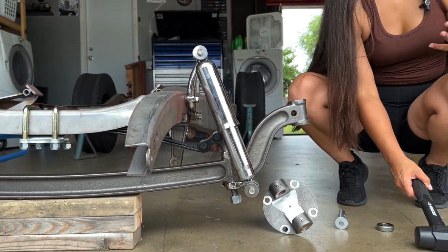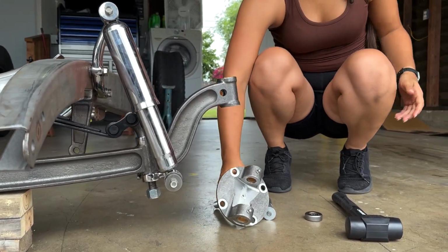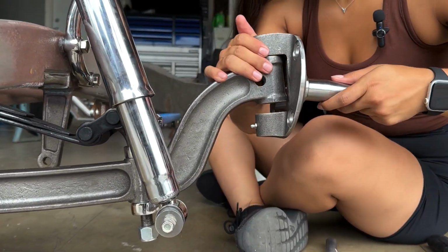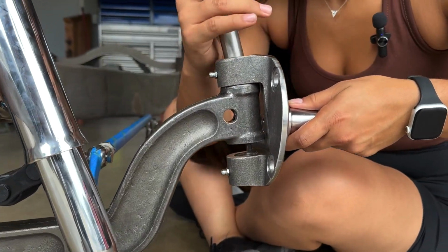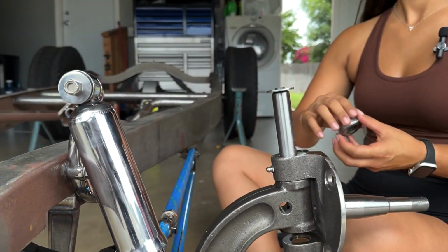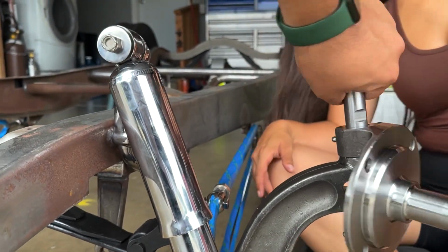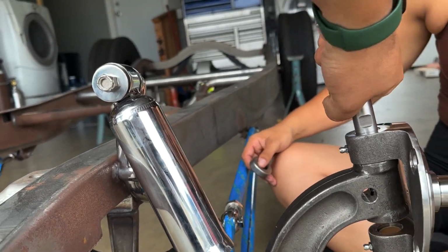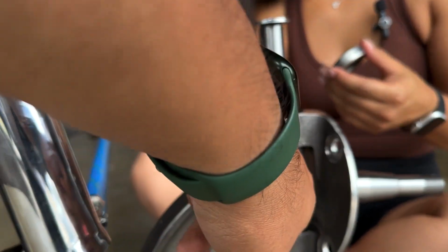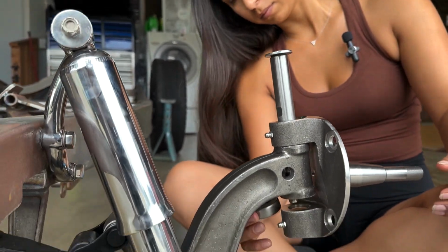It looks like glue or something on it. Yeah, it's grease from the bearing. The bearing comes packed. This one goes this way. Line up the holes. Now, just for future reference, once we're doing the final assembly, this groove is supposed to go facing that way. Then your actual bump stop and everything, that's what it keys into. And that keeps that kingpin from falling out.